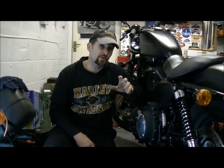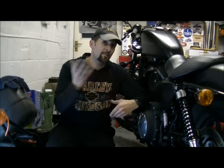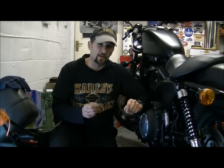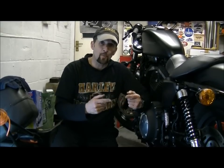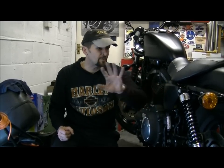And somebody asked us just recently, how do you get them off? Now we can only presume that he wanted to get it off because he thought he wanted to take the pads out and clean them up. But you don't need to. There's a really clever design on this particular caliper. They've got a simple pin that you withdraw and the pads just extract out the back of the caliper with everything in situ. You don't touch a thing.